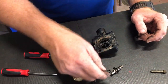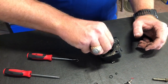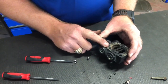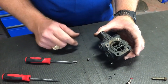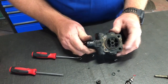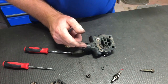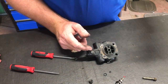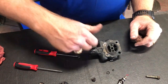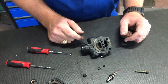Instead of spending a whole hundred bucks on another leveling valve, you want to rebuild them yourself — you see it's not anything to it, as long as you can get the bolts loose. This one broke off, that's why we had to cut it off. But I thought it would be a prime opportunity to show you guys what's inside of a leveling valve and how to replace it. Hope this helps you guys. Make sure you hit that thumbs up button and subscribe down below. You guys have a great week, we'll catch you next time.